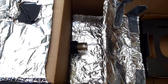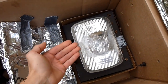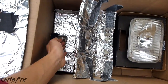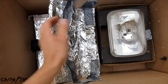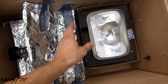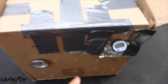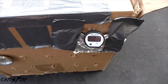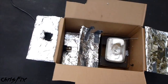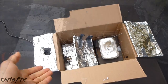For my box oven, you can see the heat gun goes in right there. This is where the headlight sits — facing up, nothing's touching the lens. Right here there's a baffle, so the heat hits the baffle and comes up and over — no direct heat against the lens. If you have any direct heat on the lens, the lens will melt. On the back I have an instant read thermometer that reads the air temperature right next to the headlight. You should also have a fire extinguisher as a safety precaution.